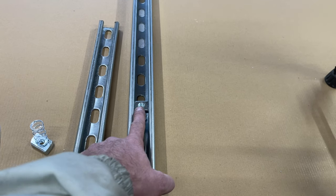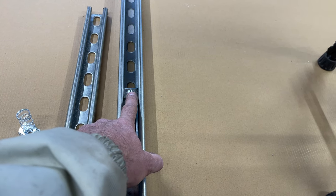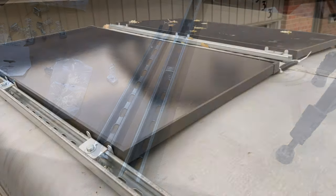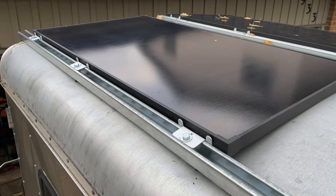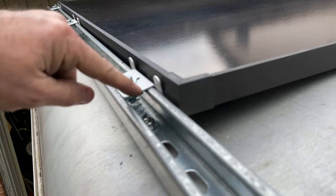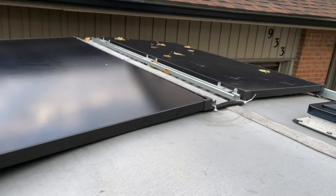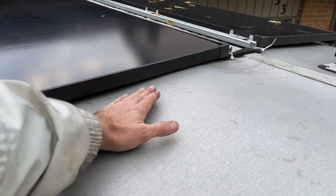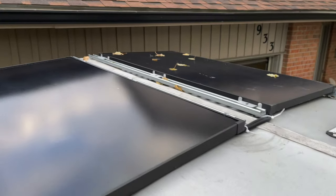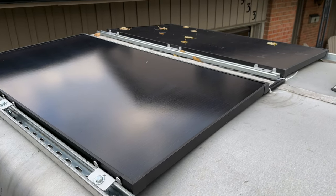For the larger channel I'm using one-inch bolts with plenty of thread locker and a big washer. Now on the roof you can see it all bolted down - the spring nut, washer, and lock-tated bracket on both sides. There's a slight bow in the roof so it may look like there's no clearance under the panel, but there is a little gap. Once I bolt down the other side, the panels are done - the hardest and most critical part of the installation.